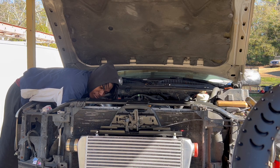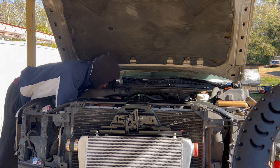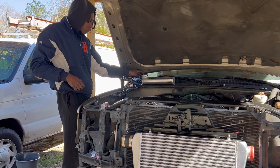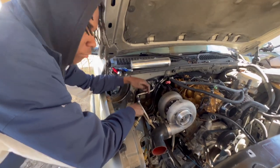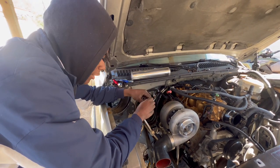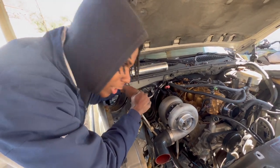I ended up cutting a piece I had to get off the turbo housing. I grinded it down and finished it with a nice smooth finish. I also had to do the manifold housing that goes to the head. We're getting everything straight at this moment, but I'm struggling with this thing — I'm not going to lie. I had to cut it, fabricate it, and now I'm trying to line it up.